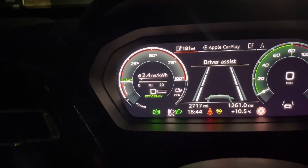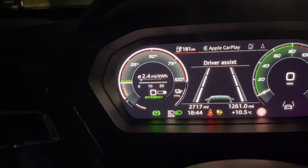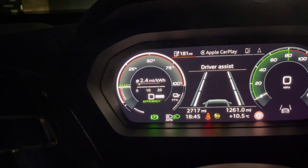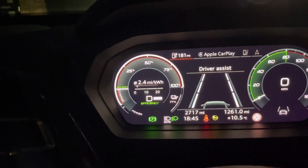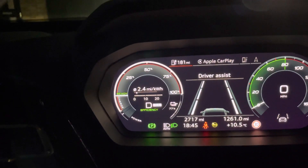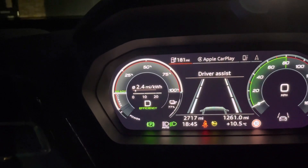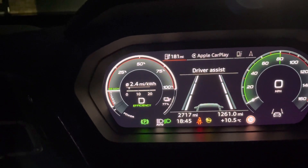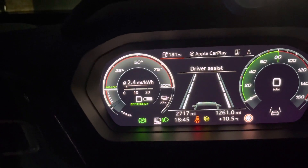And in efficiency mode, that's correct. So if I put the vehicle up to 3 regen — and by the way, I'm sat on a private driveway at the moment so there's no risk to anyone — if I lift my foot off the brake and press the accelerator, you'll see that immediately the regen goes back to 0 and I have to reset it to 3 if I want to.